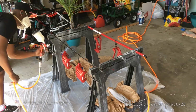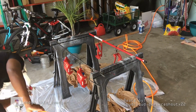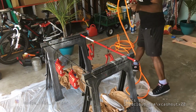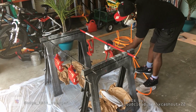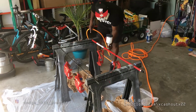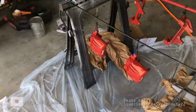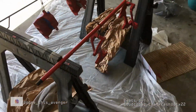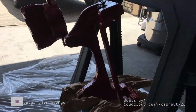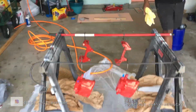So in this video, you're seeing me add a clear coat to the brake calipers to protect the caliper paint, and I have the brake calipers suspended with zip ties. This gives me better angles, which allows me to add clear coat to every part of the calipers without having to flip them over. Like I said, I added clear coat to these and let them sit for a few minutes, and in the next video you're going to see us put them in the oven for 20 minutes and pull them out of the oven.